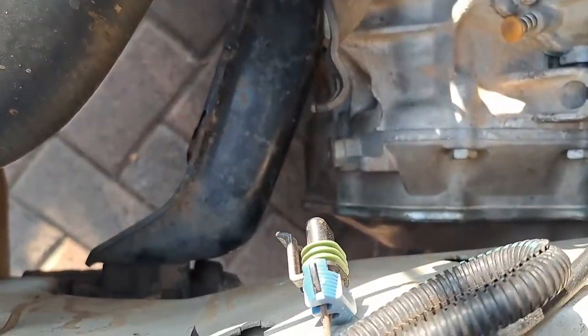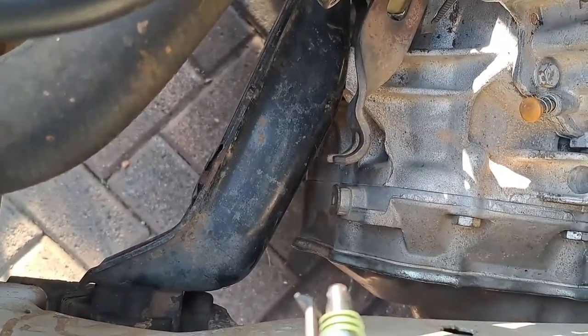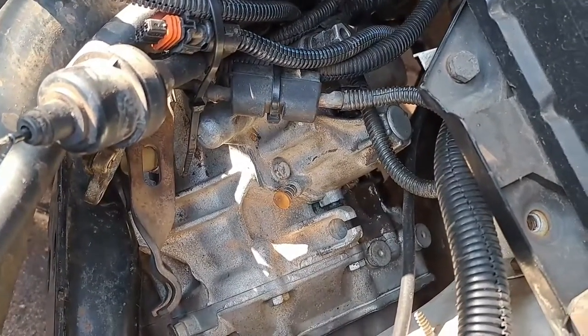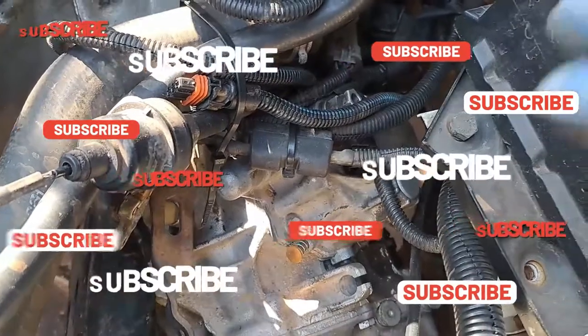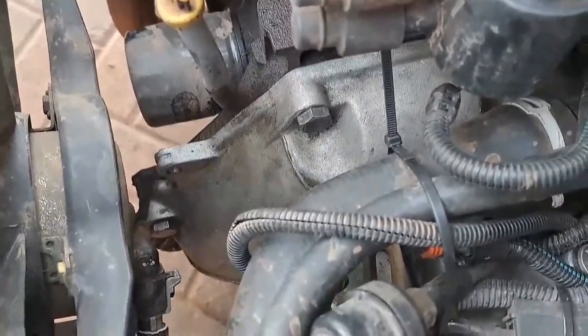So all I've done today so far, starting this morning, I have put back this engine mounting and I've torqued the bolts. The torque specification for these bolts was 72 Nm. I'm going to do the back main engine mounting and then torque the bell housing bolts, so that the gearbox is definitely not going anywhere. I've tightened and torqued all the bolts around the bell housing. All the engine mounting is on and the stand is gone.